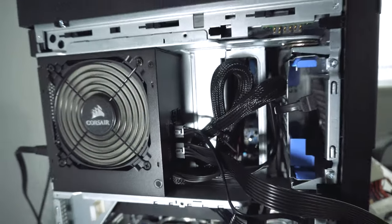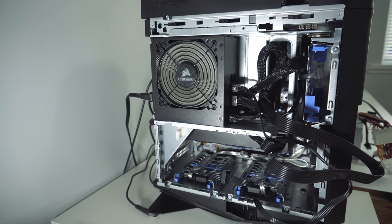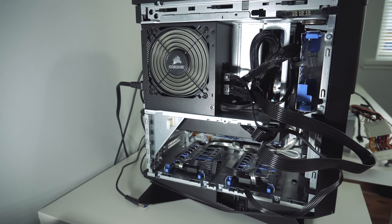So that's the process of how to replace or upgrade the power supply unit inside an Alienware or gaming PC. Like I said, it's a very easy and simple thing to do. Now you have a more powerful power supply unit in your PC. Generally, a 650W PSU is enough to run very high spec configurations — no matter if you have the 7th, 8th, 9th, or even 10th Gen Intel Core i7 or i9 processors, and even with the current RTX 2080, GTX 1080, or 1080 Ti. Even the original 450W power supply unit can handle an Intel Core i7-8700 or 8700K with GTX 1080 graphics cards.